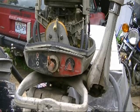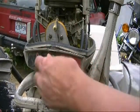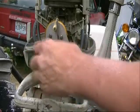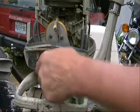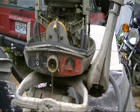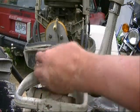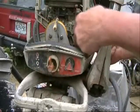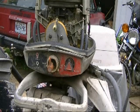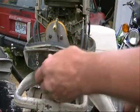A lot of these older motors have fuel mixture adjustments right here on the front. The outside one — your high speed mixture — can be unscrewed all the way out. When you do, it will drain the fuel bowl into, in this case, the boat. So if you want to catch this fluid, put some kind of container there. You just pull that out and here comes the nastiness — that was some pretty dark brown ugly looking stuff. Also over here on the side there's a glass fuel bowl. You may want to loosen the little nut, dump it out, and put it back on. Mine happens to be pretty clear.